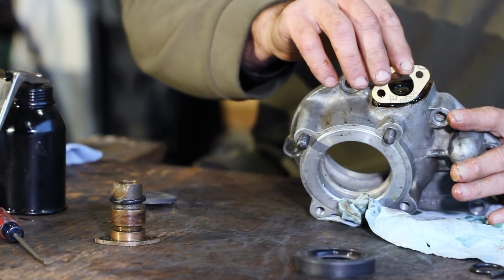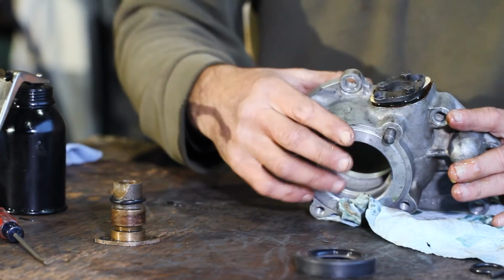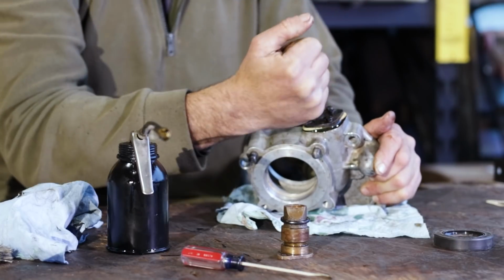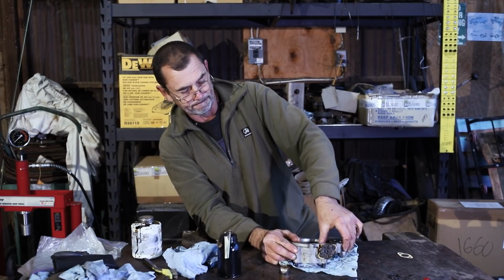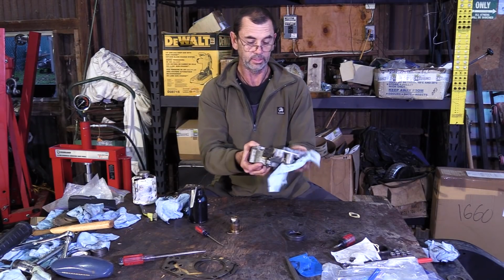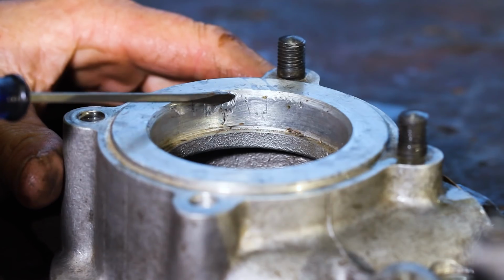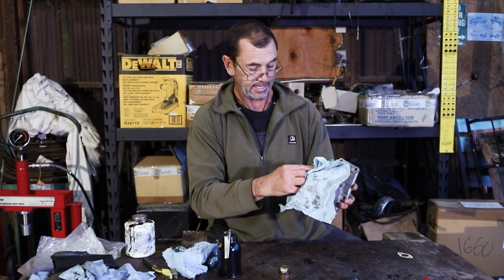We have a gasket. And we have our cover plate. And then our screws. So I think we remembered everything. Okay. The pinion spins. That's good. Alright, last thing we need to do now, I think, is install the seal. So we'll apply some goop, warm up the housing. Now it is a little beat up, okay? It is a little beat up. I could see this leaking, so we're going to stick a good wad of this muck in there as a line of defence.